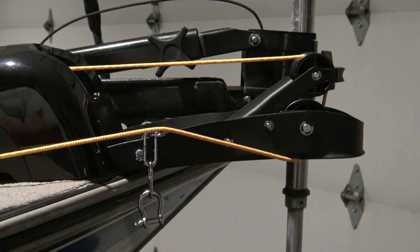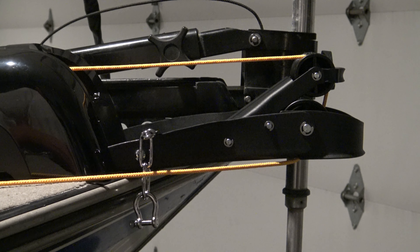Other than that, it's all mounted and ready to go. I hope my tips and tricks helped you out — using stainless steel hardware, using the rubber washers, and always stowing the anchor inside the boat instead of stowing it up on the unit. Because if you're bouncing down the road, all that weight is going up and down on the front of your boat — I think that's a bad practice to keep it up there. I hope you guys enjoyed the video and learned something from it. Thank you for watching.